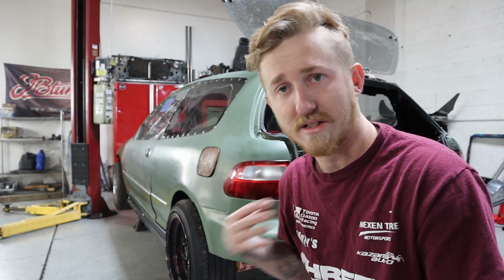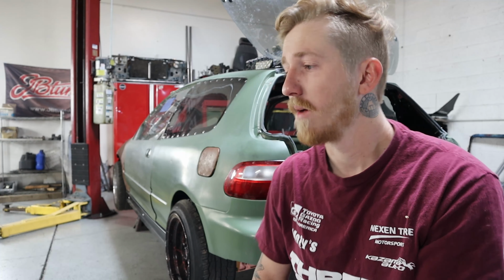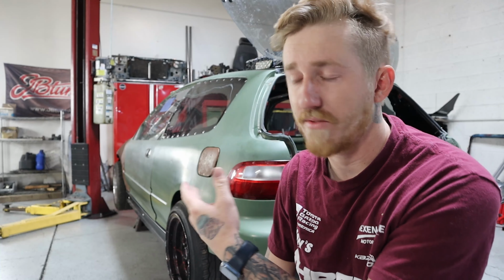That was my first time doing that, and that's why, again, I took the job on, because for me, that's a learning experience right there. I didn't know how to do that before, and now to me, it's like, oh, wow, that was easy. Normally, you would either build the cage on blocks and drop it off the blocks, or you would build it like this with plates, and then you would go down. I think the blocks are a much more efficient, cleaner look, but in this case, now I know if I ever have to do this style of thing again, I know how to drill the floor out, because then the plates cover the holes, you weld it all up, you're good.